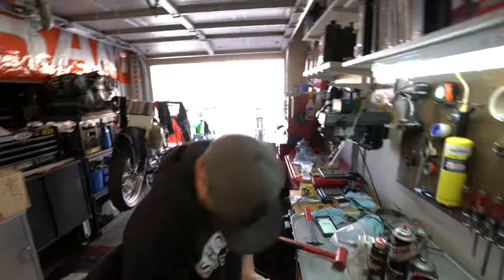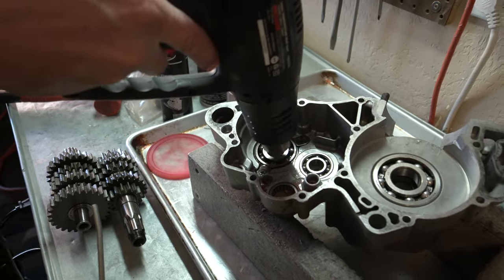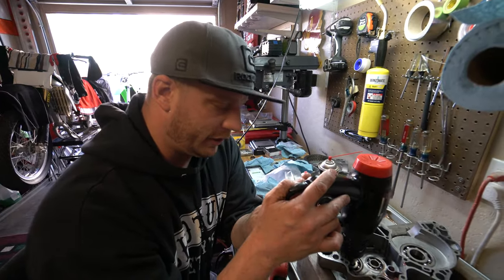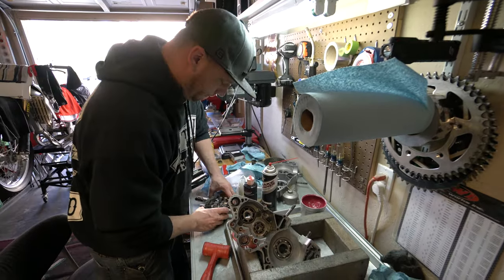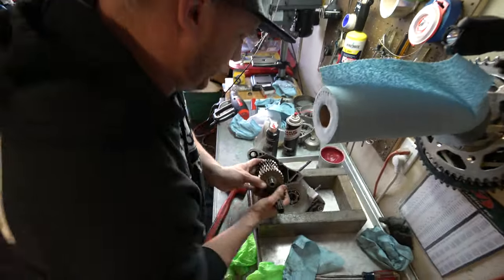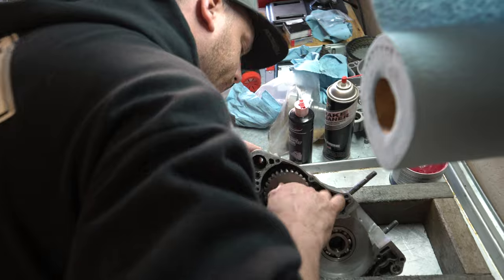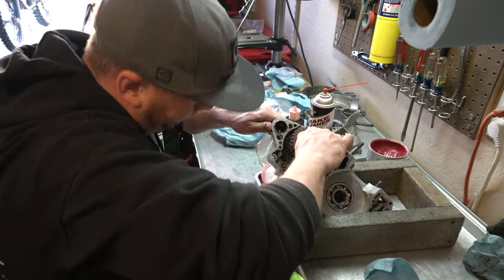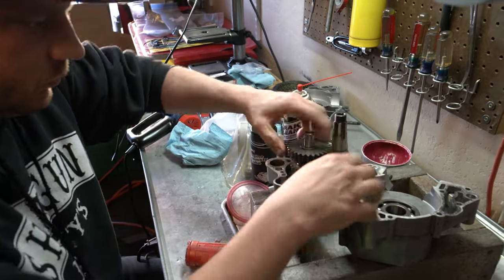It's getting caught up — the gears slipped off, so I have to back up and try again. I'll just tap this out and give it a round two. We might be getting some resistance from this bearing, so I might just throw a little heat on it. In this case I'll use the heat gun again — I won't use the torch, we don't want to torch that bearing. So we're using the heat gun to expand that bearing a little bit to allow the transmission to slide in easier.